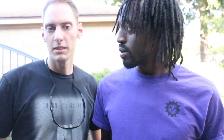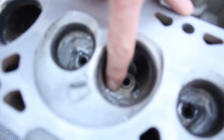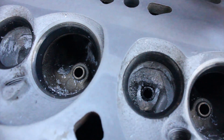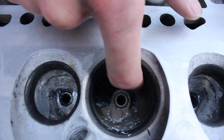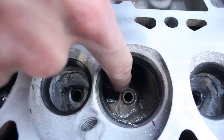At this rate I think we'll be done in a day or two — and it's coming along a lot quicker than I thought it would. What we're going to do is knock down the swirl ramp right here and try to match it to the other side so it's symmetrical. That'll give us a lot more chamber space, we'll widen it a bit through here, define the shape, and it should flow air like crazy — awesome CFM.